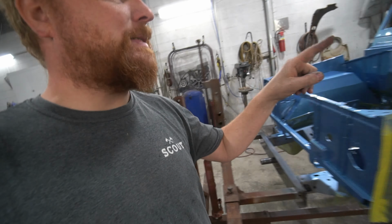We'll back tape it, and we'll probably spray some bed liner in there in the next couple of days. I still want to give the paint some time to harden up. It's just a hair soft, just a tiny bit, it fingerprints a little. So we'll let it sit, and as we polish it, it'll cure out a little bit faster over the next day or two. So that's the plan. We're going to grab some wet sandpaper and compounds, get everything set up, and then do some sanding.